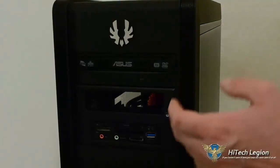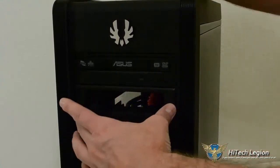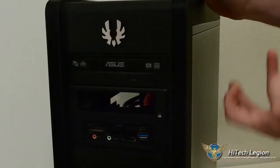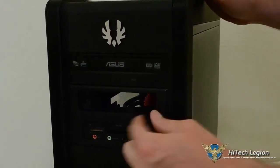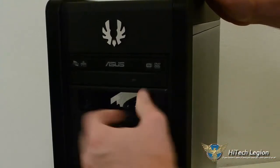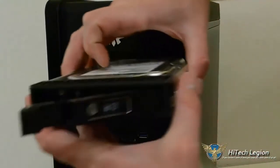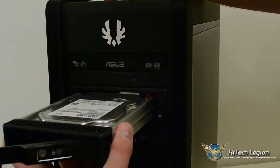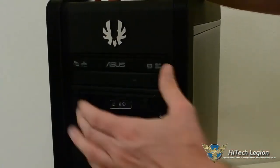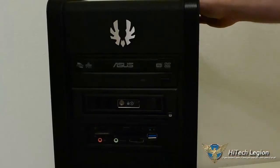The Vantec M3500 mobile rack fits right in — it's a pretty snug fit. I use the standard clips that come in this case, though of course it comes with its own screws so you can make it really secure if you want. You can see the right side without a clip wiggles a little bit, so I'm concerned it might give a little over time with sliding the hard drive in and out. You just slide in the hard drive, it plugs right in and done. It gives you a nice clean look, at least while it's in there.